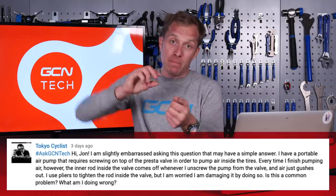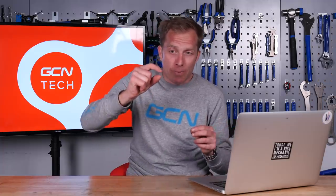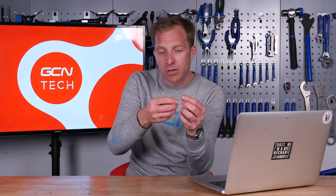Those pumps screw onto the actual valve itself. When you put air in, you create a really tight vacuum between the adapter of the pump and the inner tube or valve. Unless that valve core — the central bit — is done up really tight, they tend to unscrew the valve core when you unscrew the pump from it. It's incredibly frustrating, especially if you've just pumped up a tyre and you're running short of time. Some pumps have a tiny pressure release valve close to where it screws on, which releases the built-up pressure so you can unscrew it — but even then, sometimes they still undo those valve cores. So what you've been doing with a pair of pliers on the valve is absolutely the right idea.